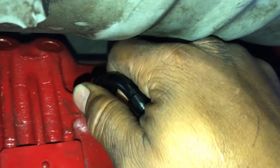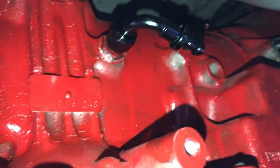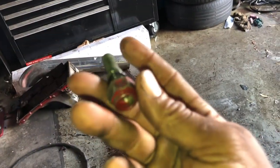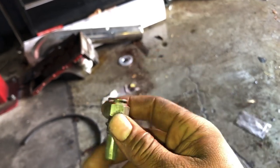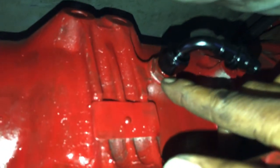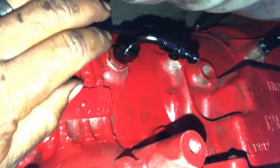All you do is you're going to pull the old ones out of the transmission. The old ones look something like this — it's a three-quarter or 19mm to remove it. Take these ones out; normally they're in there just like that. You're going to remove those, install this piece, and then install the AN6. This is a 90-degree fitting — some people use 45, but 90 degrees is better to me.